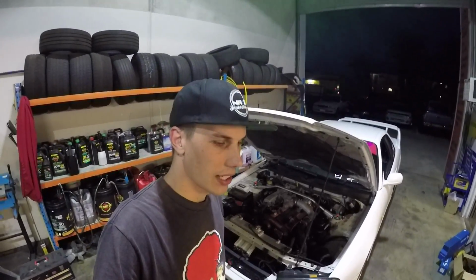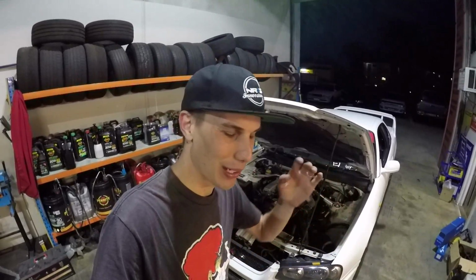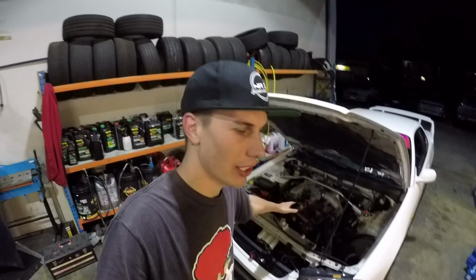The main reason for that is when I did this radiator upgrade, I did something really bad that you should never do, and I put Chinese fans on it. Just generic no-brand Chinese fans. I mean, all the fans are from China pretty much, but you know what I mean. Anyway, they don't push enough CFM, not enough airflow goes through them, so we're gonna change one out for a really high CFM one. I think it's like 1800 or 1700 CFM, which will be good.